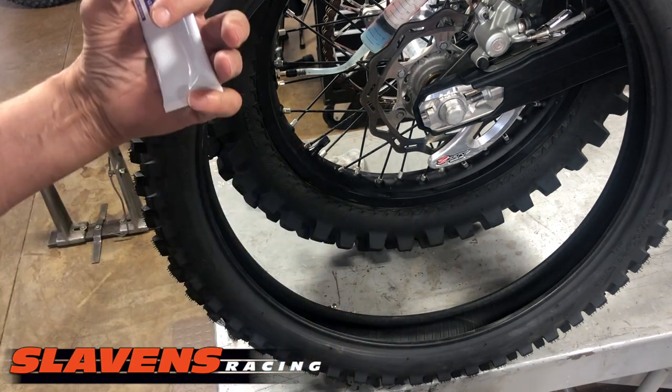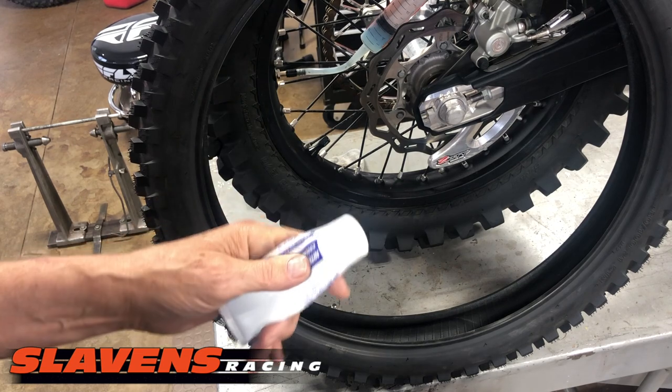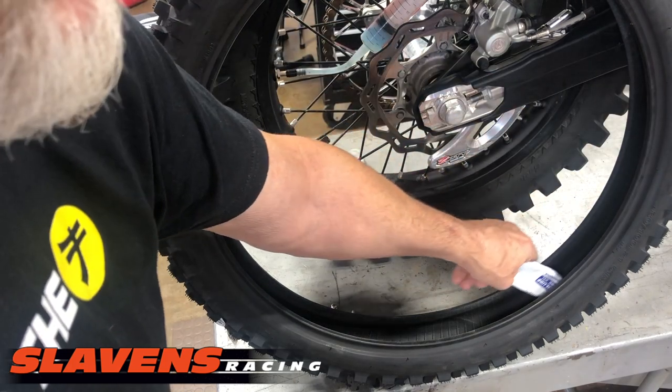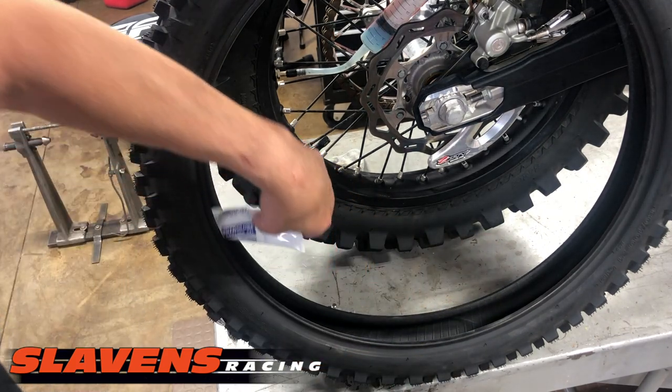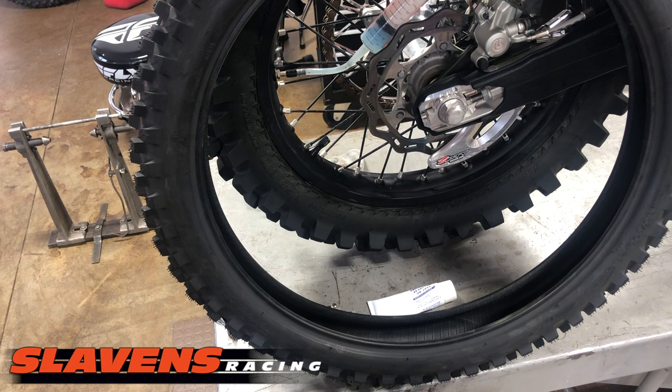It shoots back out at you, gets on your clothes, all over your hands and arms — it's a pain. The easiest way is to just remove the cap and squirt the lubricant in the crown of the tire — the very top, deep inside — squirt a bead of it all the way around. Tubeless tested this: they installed it that way, then installed the mousse dry, mounted the tire and mousse on the wheel, went out and rode for only 15 minutes. When they came back and tore it down, the lubricant had already spread everywhere on the mousse and tire that it needed to be.